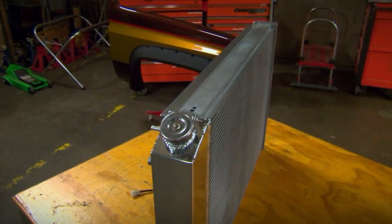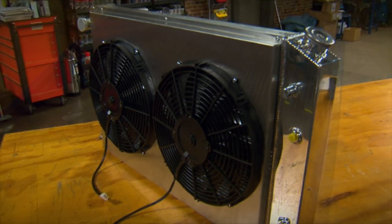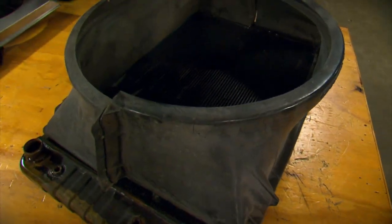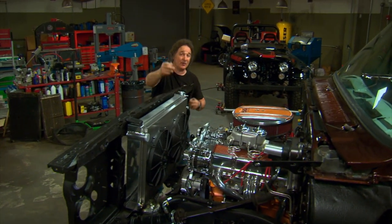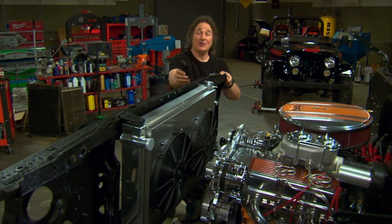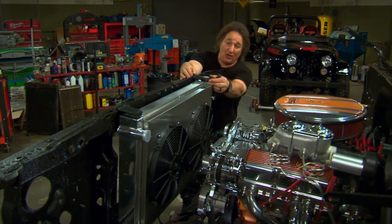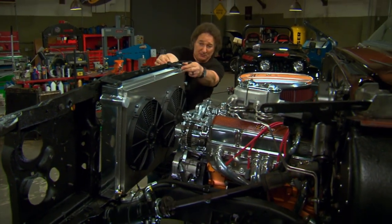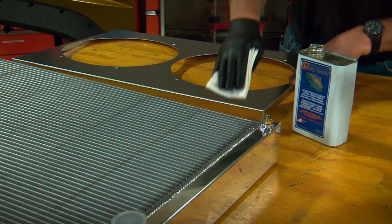This combination has the capacity to cool a big V8 as it idles in traffic on a hot summer day with the air conditioning on — far more efficient than that original radiator with its mechanical fan and big plastic fan shroud. This Frostbite radiator is designed to bolt right into your square-bodied Chevy truck. However, if you've upgraded to a larger big block radiator like we have, your stock small block mounting brackets might be a little bit too small to fit. You'll either need to go to LMC and get the proper mounts or just modify these ones to fit. And if you want to keep all that aluminum looking good, you may want to seal it up with a coat of Shark Hide.